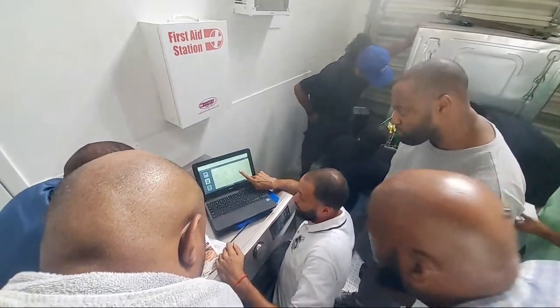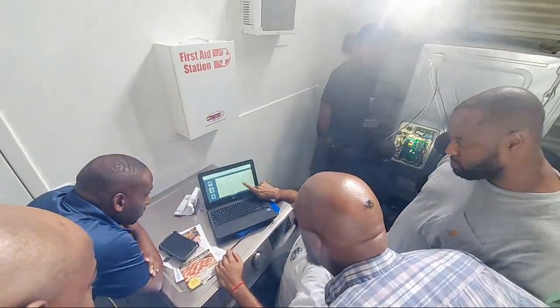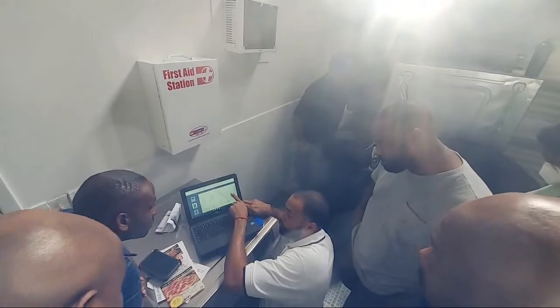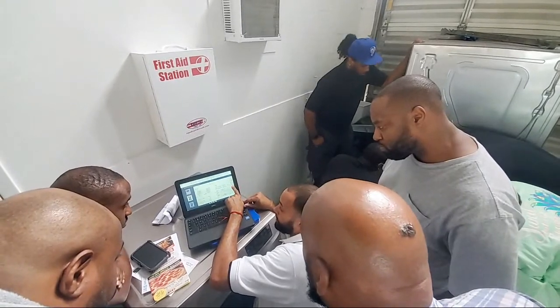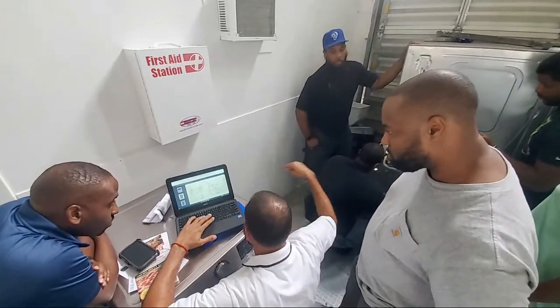You know why this is F and R? Because you got two heater elements. You got two evaporators. You got one in the refrigerator, and you got one in the freezer. They both share the same neutral, that gray, which then goes under that L1 line and taps into that neutral right out to the wall. Y'all with me?